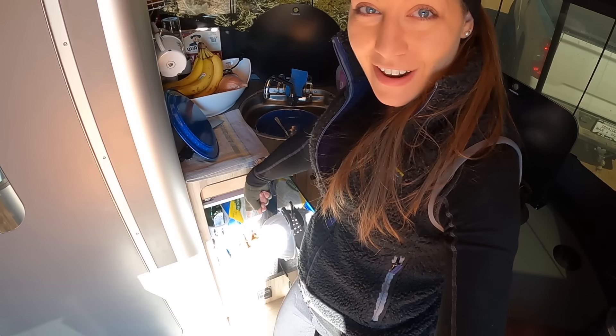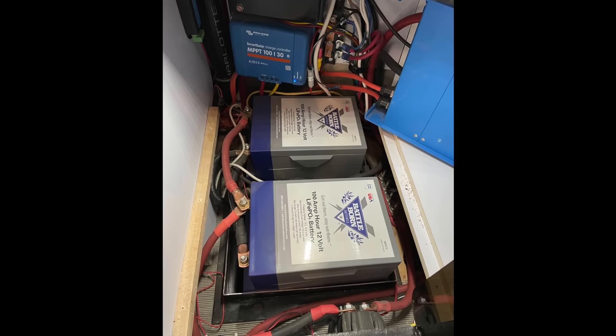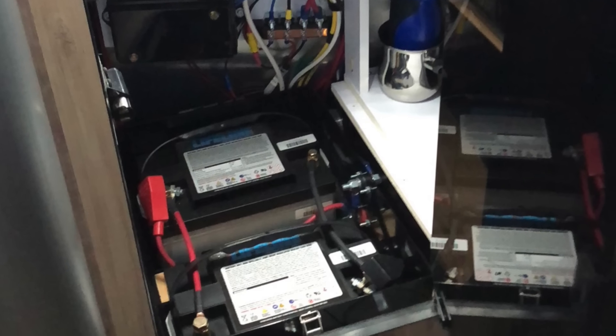The other huge thing that made a difference is lithium batteries. In the Base Camp 16, the batteries are underneath the cupboard floor — it's built into a battery box and is a pain to get to. Along with the solar, I ended up upgrading my AGM batteries to lithium. I wasn't aware when I first bought the RV that you cannot run AGMs below 50% without reducing their capacity. After six months I had already started to damage my batteries because I was constantly running them really low — I charge two laptops for work, plus hotspots and personal items.